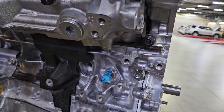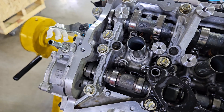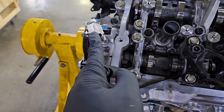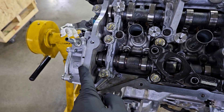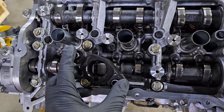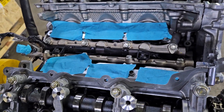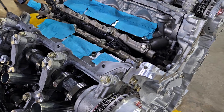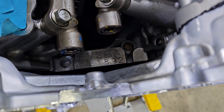You can see the sealing there - that's what you want: a nice little thin strip. You don't want it bulging out or a lot of sealant oozing out, just a nice little groove and bead. This is the vacuum pump you're looking at, driven by the camshaft. Here's where your high pressure fuel pump would sit, also driven by the cam lobe. Looking down where the intake valve is going to be - this is where your intake ports are. You can see I have it taped up, and you see that stamp there: V35A.